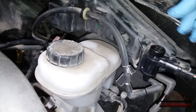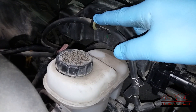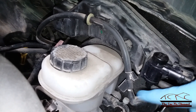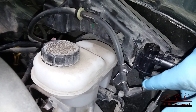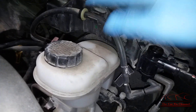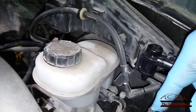Right here is the vacuum tank and this is the one-way check valve. This is the IWE vacuum solenoid. You've got some hoses — this hose goes down to both front hubs, and this is the supply vacuum hose coming from the engine. I've already checked all this: the tank is good, the solenoid is okay, so the issue has to be down by the hubs.